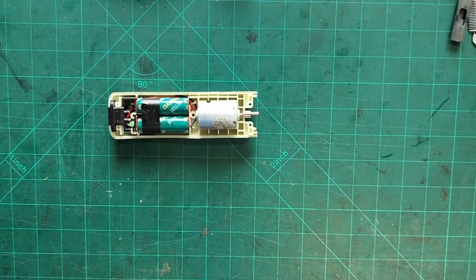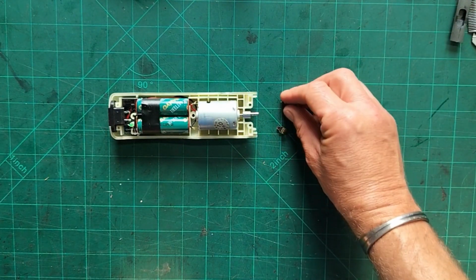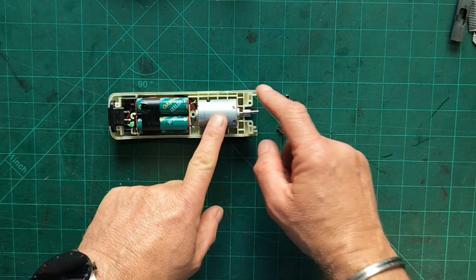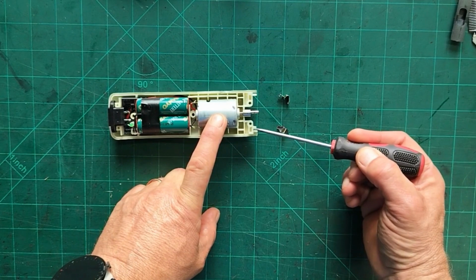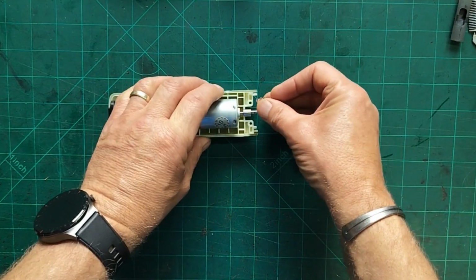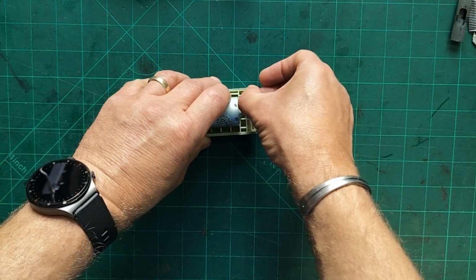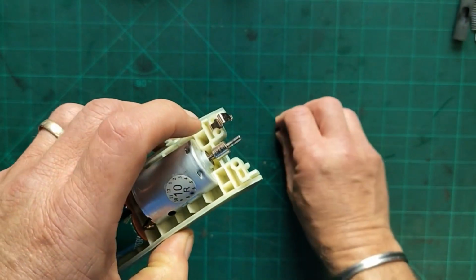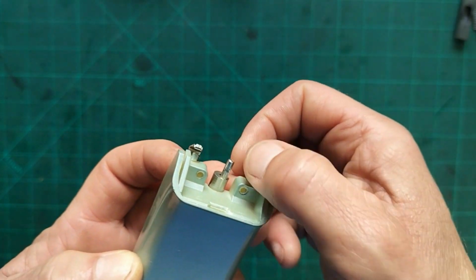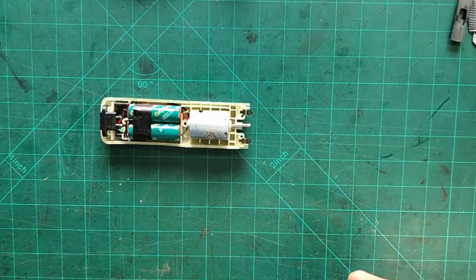The other thing we've got to put on then, before we put this casing back together, these two clips on here. So these clips are designed to hold part of that blade fitting together. They just sit over the top. I have noticed when I was cleaning it that there's a plastic lug there and there isn't one there. So I'm guessing at some point that broke off. So I'm going to roughly line that up as to where I think. All they do is get in and clip across. So they just sit across there and clip in. This one's going to be the same on this side. Sits and clips in. So you can see there what they're going to do is catch up on another part of it. They're the only bits that need to go together before we can put the case together.